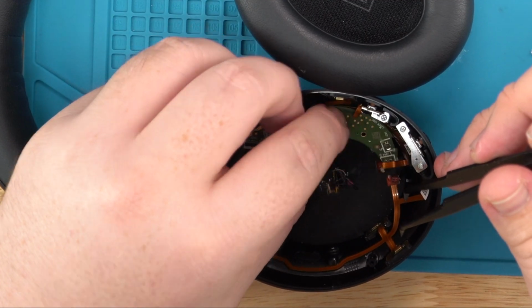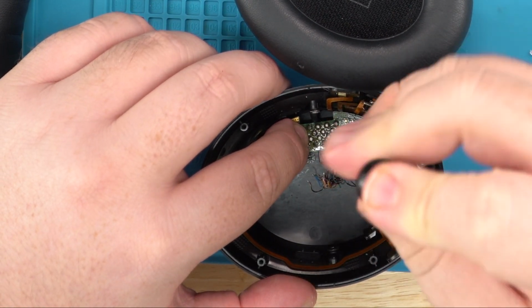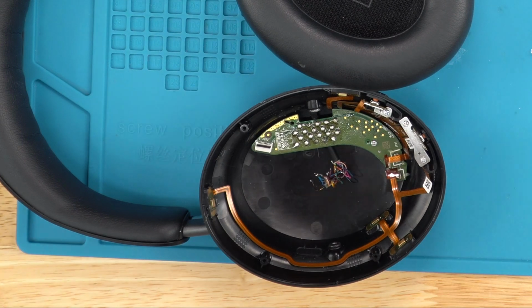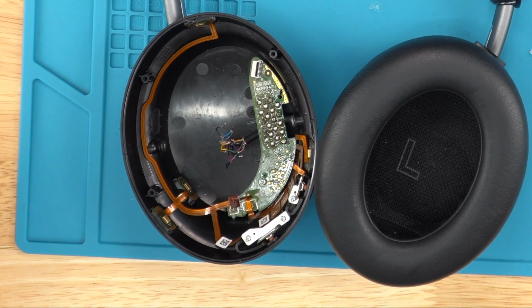If I could just make this look a little bit easier. There you go. You want to screw your board in, not too hard. Once it stops giving, don't go any further. You'll go right through the board and ruin your head. Now you want to work your way back up with all the soldering. You want to work bottom row, middle, top. Simple as that. I could zoom in a little bit. Mainly you're gonna see my hairy hands, but we'll make it work.